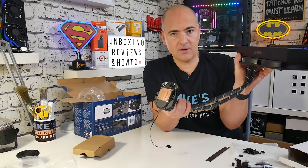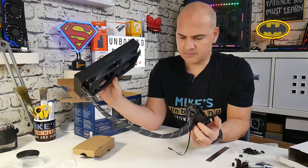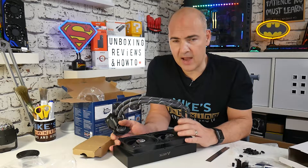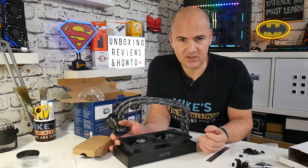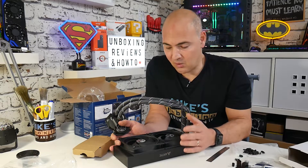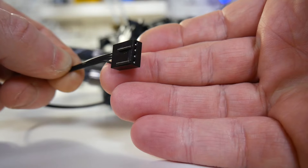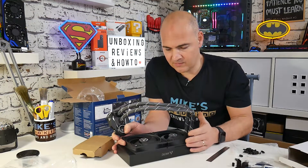These are the P-series pressure-optimized fans — very, very nice fans, very quiet, they do a great job. I think they're 200 RPM to 1800 RPM. They also support zero PWM or zero fan mode, so if your PWM signal is below 5%, the fans won't spin at all. So if you get this in your PC and you first start it up and the fans aren't spinning, it isn't a problem — it's just doing what it's meant to do. Obviously if they don't start spinning after a little while, check your settings and make sure you've got everything plugged in right. Because you've only got the one 4-pin PWM cable to plug into your CPU header, once you've done that, gone into your BIOS, and run your optimization so the motherboard can detect the high and low points of the PWM signal, you're totally good to go.